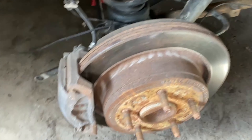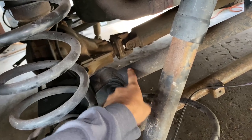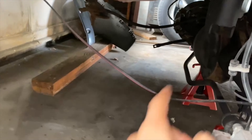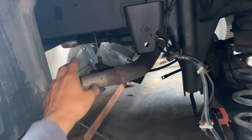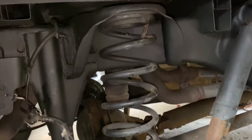On the back I'm gonna be replacing these rotors and then this shock — I need to dismount it from the top. I believe we're gonna replace the upper control arm with one the exact same size — I'm not sure why it came with that but eventually I'll replace this one too, probably not in this video. We're also replacing the spring. We dismounted the sway bar and the track bar. Basically we're gonna have to jack up the truck a little from the hitch, lower the diff with the jack, and then get everything installed in the next video.